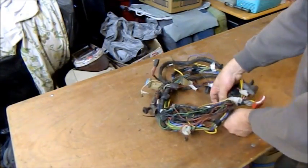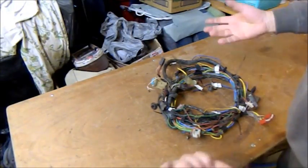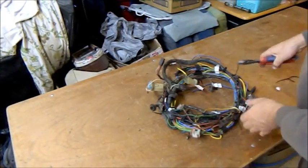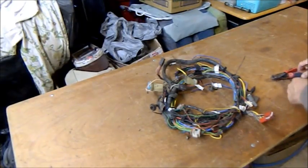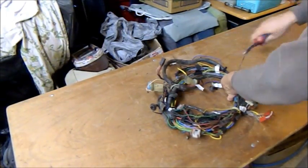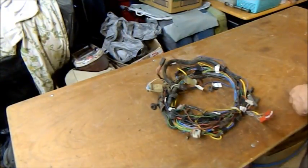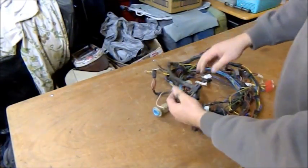this because, being a Fairlane one, it has a few differences, like it has 4 headlights instead of 2. But not just that, it had also been meddled with a little bit. And I'm going to do a little bit of fiddling with it as well. Now, one of the first things I'm going to do is remove the resistor wire for the coil. I don't want a 7-volt lead, or feed I should say, going to the coil. I want 12, because I intend to use an electronic ignition.